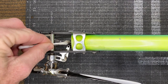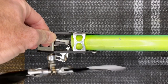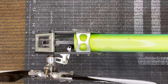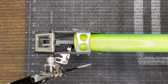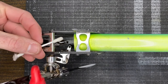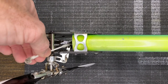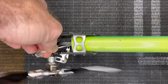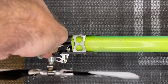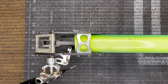You can see the color difference in the belt — it's still a little dry so go ahead and put a couple more drops on the belt and continue to spin it. Rotate your Q-tip if needed and walk it back and forth. Now we have good coverage. That silicone will absorb into the belt and dry. Now do the same thing on the inside of the belt — douse your Q-tip in silicone oil again and hold it on the inside while you rotate.